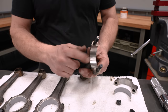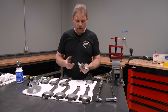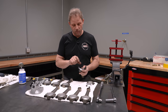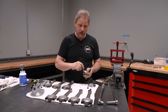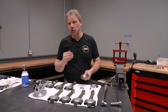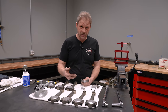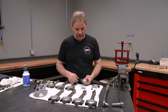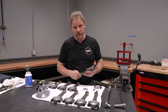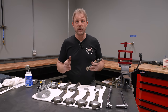Rods are resized on the big end and new bolts are pressed in and I also have my new bearings. So today I'm going through and I'm putting my bearings in, getting all that done and measuring what my crank needs to be cut to, because that's down at the crank grinder and he's basically just waiting for numbers from me. And then most importantly at the end of the day, we're going to get over to Thoroughby's because our pistons are in. So we're going to get them stuck onto the rods and also get that block bored so we can keep moving on with the process.